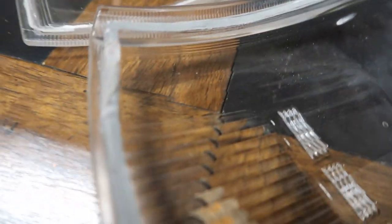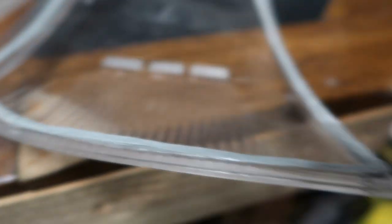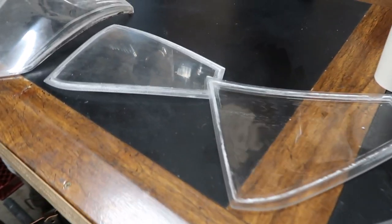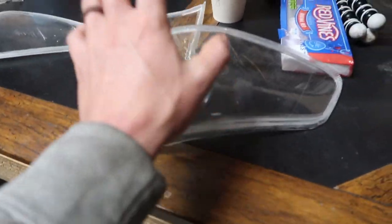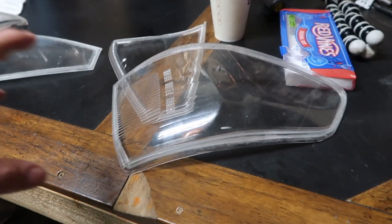I can never quite get off these little ridges that are actually in here. The center ones came out completely fine — it's all smooth — but I don't know what to do with this little edge right here, and down in there it's got ridges going down the whole outside plus a pretty complex curve to try to sand. So my best bet is to just remake these the best I can. The inner ones are going to be pretty simple because they're pretty flat, and the outer ones are going to be a little more involved, especially because they've got a couple bumps. I definitely want to abandon these and make new molds so I can make multiples down the road.